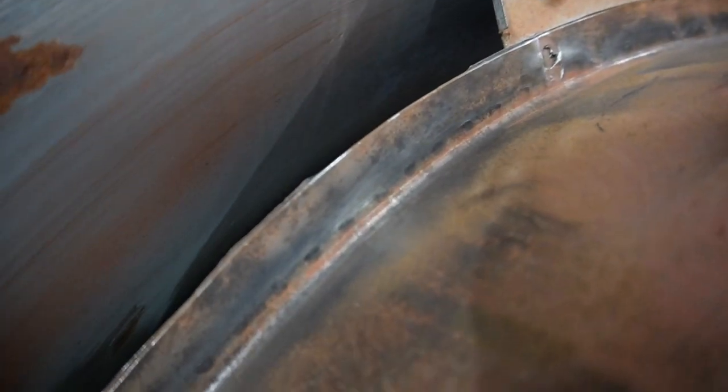Well, this is interesting. Haven't seen this kind of spot welds before. If you take a look, it looks like they had tiny little spot welds all along that inner wheelhouse, only about half an inch apart all the way around. So that'll be quite interesting to try and either drill all those out.